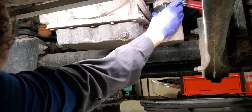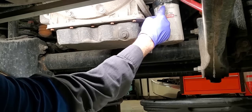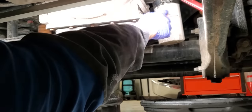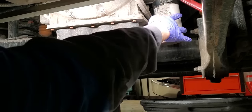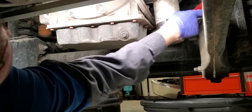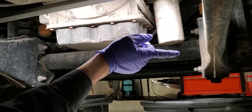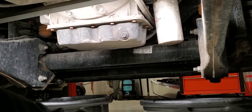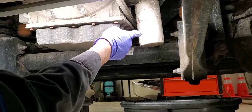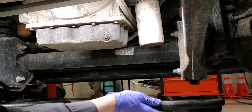Work the strap all the way up to the very top — there's a big metal ring at the very top of the filter. If you do it down lower you can crush it if it's really tight, so go up to the top where you have a lot more material behind that thin skin and you'll be able to get your oil filter off. That wasn't too bad. Now if this truck was hot, it's going to start dripping oil right away and be a real mess. Since it's cold, I'm most likely going to be able to spin this all the way off before oil starts dripping.